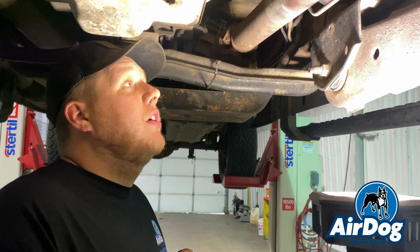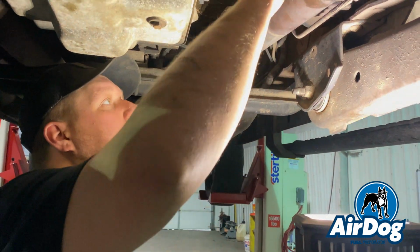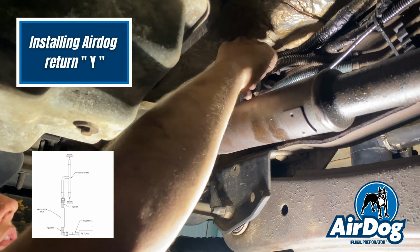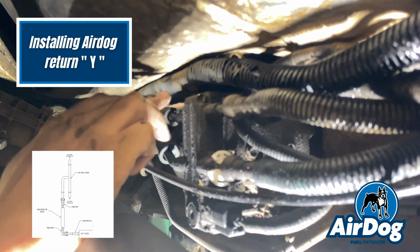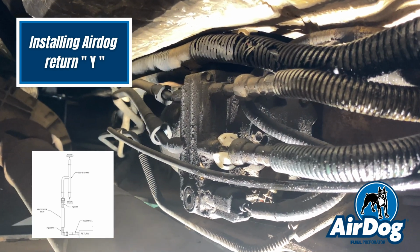So we're here at the factory lift pump. We're going to go ahead and prep this for our filler neck return tee and outlet line of the Airdog. So I went ahead and put on our 3/8 fuel line disconnect tool. We're going to disconnect this 3/8 fuel line. This is where the Airdog outlet is going to connect. Then we're going to disconnect these two top fittings. That is where your Airdog return Y is going to install.